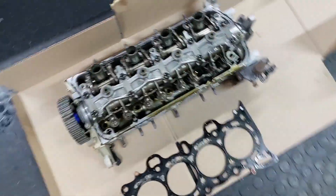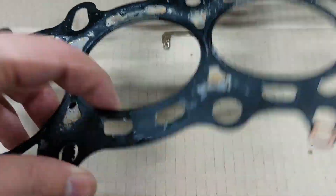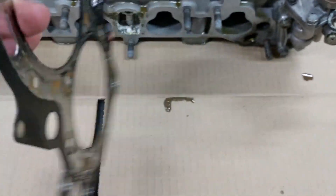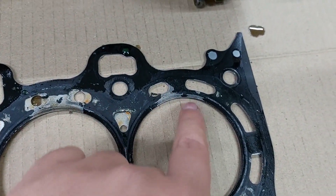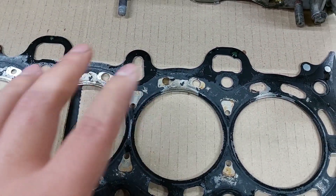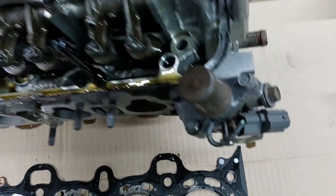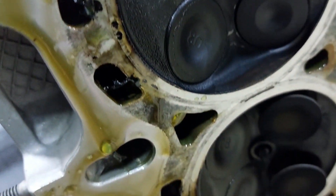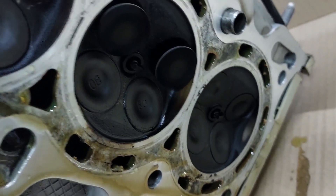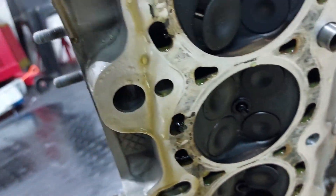We have the head over here now. I must say once again I think it is best case scenario out of a bad scenario. If you look at the gasket over here you can see — this is on the back of the engine — the head gasket was blown in this area, there, there, and here. So yeah, it looks like changing the head gasket is going to solve the problem. It did just blow the head gasket — it didn't overheat or anything like that — so we won't have a warped head. I had a quick look at the head: these valves all look fine, chambers all look the same. Yes they're all very black, but that is just because the car is running very rich because we haven't taken it back for a tune. Other than that I'm actually quite happy with what we're seeing.